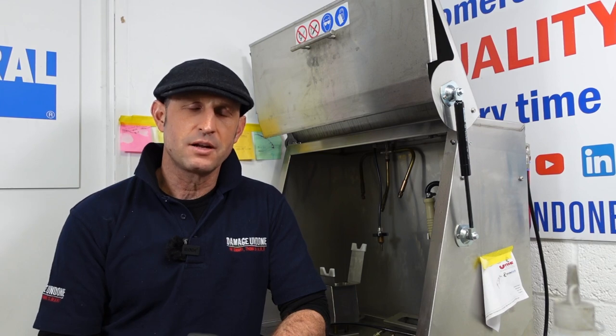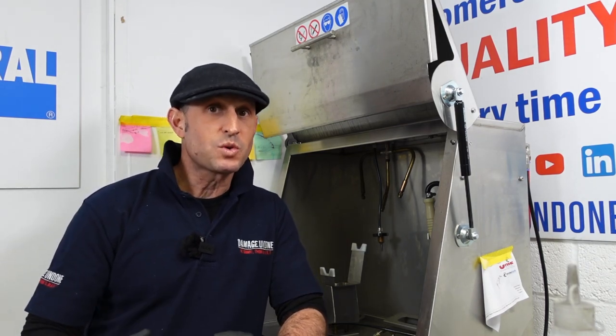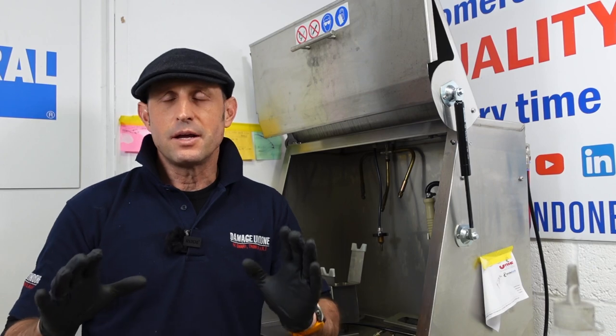I'll give you a little bit of history about gun wash machines. I was a little hesitant to use this machine and to do this review. The reason for that is, in the past, I bought a very expensive gun wash machine from a company that said exactly the same — they've got a dual cleaning fluid that will clean both water-based and solvent. The machine looked really nice, like it could be in a Formula One garage. So I took them at their word and I bought the machine. It cost me a lot of money. Six months down the road the machine started to rust. Within a couple of months I realized that the fluid would clean the water-based paint, but it was never cleaning my solvent gun. There were always little bits of contamination left in my solvent gun, or I would end up with little fisheye craters in my paintwork where you couldn't get rid of the cleaning fluid in the gun properly. Their solution was to use a solvent base cleaner to clean it, and it was just an absolute disaster.